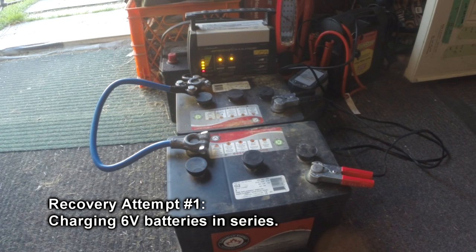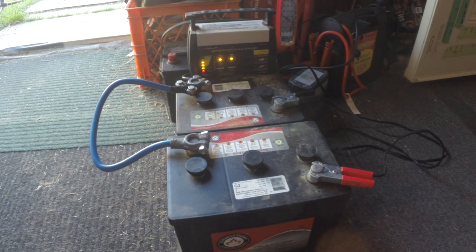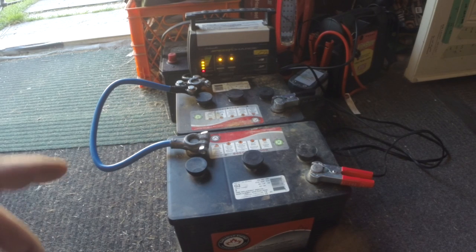Ever since the cars came I've been having battery issues for the Merc. This battery I bought in September of last year in Trenton — we were having so many problems trying to get the ignition solenoid to activate. The nearest we can tell is that it's not actually a six-volt solenoid, because neither of these batteries was able to close it and keep it closed. That aside, this was still the battery in the car when it was delivered. There were no accessories on but it was still connected, so some kind of leakage somewhere, and it was flat stone dead.